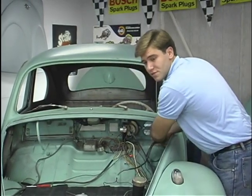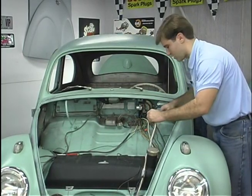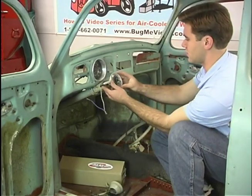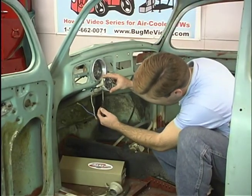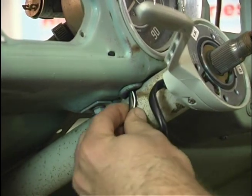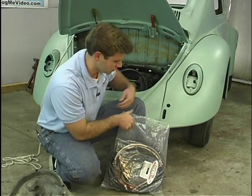Make sure you don't force them — if it feels like it's snagged on something, let the person in the back pull it back just a bit until it comes freely. There are our right tail light wires. Now we're ready. It goes on just about the same way the other one came off — slides over into place. Make sure your arm is parallel with the bottom of your dashboard. Guide the wires through one at a time, straighten them out, and push the wire loom through.